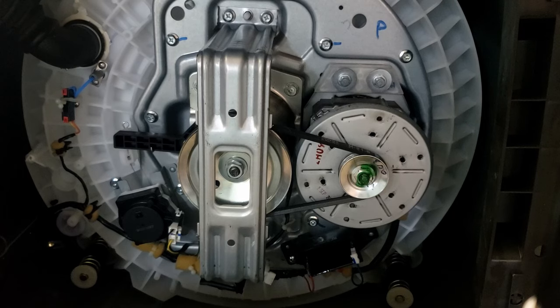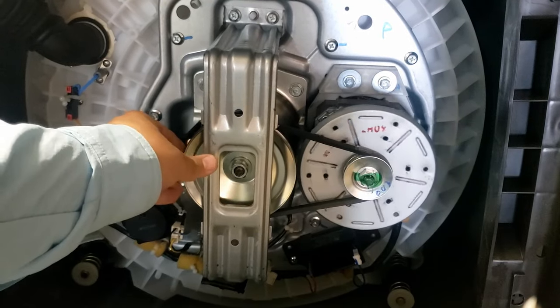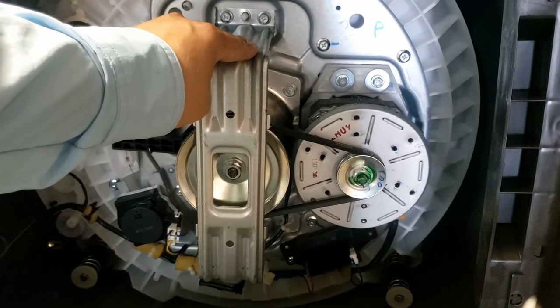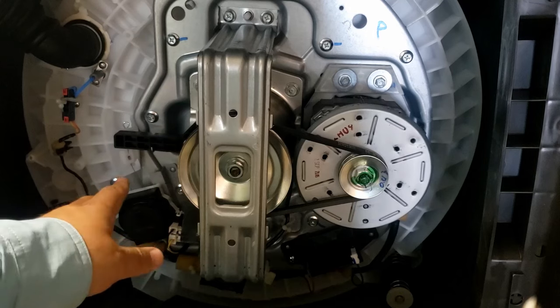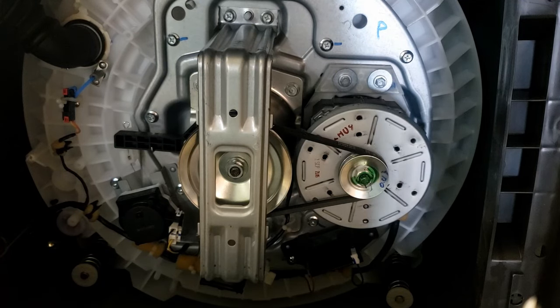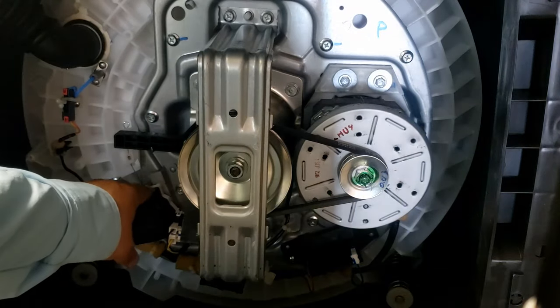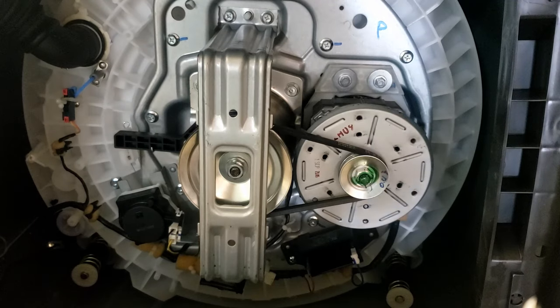This is the underside of the Samsung WA40J3000AW washer. This version has a traditional motor and transmission system. There are some Samsungs that have a large motor — almost dinner-plate sized — but still have this bracket; the fixes are actually pretty close to the same for both types. Generally what happens with this code is something in your component system — your shift actuator, your capacitor, or your TMR sensor — has something bad going on. Traditionally with this type of washer, it's because it shakes and vibrates so much that a wire can come unhooked or simply be severed.